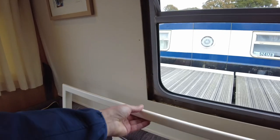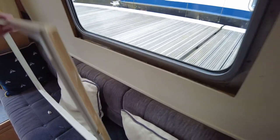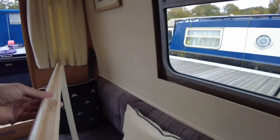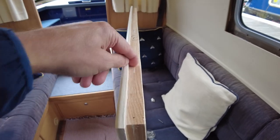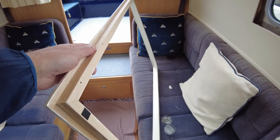These bolts come through about 5 millimeters, so the next modification you have to make is to the wooden frame. If you left it as it was and expected it to mount flush, it's not going to do that — you'd get about a 5 millimeter gap because the wood did go all the way to the bodywork. So this section here, which was about 28 millimeters, you have to carefully slice 6 millimeters all the way around the inner part of this frame to make it fit.